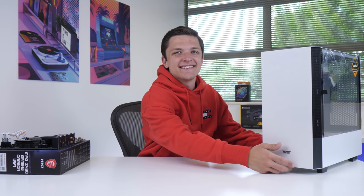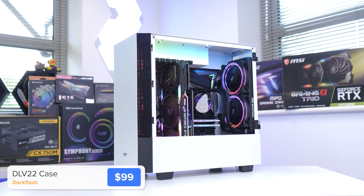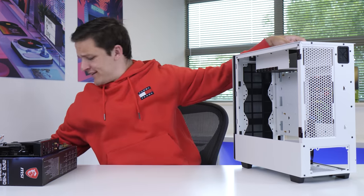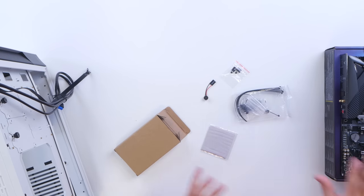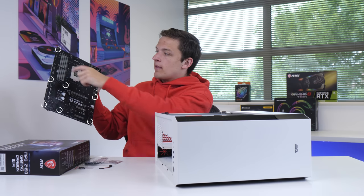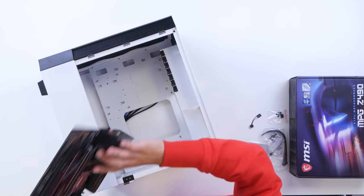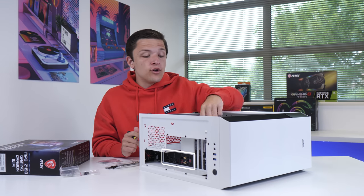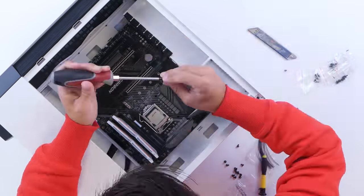I'm next going to grab our case, and this is a really unique chassis because the motherboard goes sideways and our GPU is going to go vertically. Take the tempered glass side panel off, then do the same for the rear panel. We'll grab the little brown box of accessories to install our motherboard into our chassis. With the case laid down flat, I'm going to grab our motherboard, check that beneath each of the holes on our motherboard we've got a gold standoff in our case — which we have. We're then going to slide our motherboard into our case and feed the built-in I/O shield out the back of the chassis. Then I need to remove the M.2 cover to access all our motherboard holes before using the included screws to secure our motherboard into place.